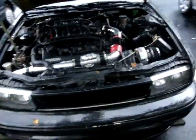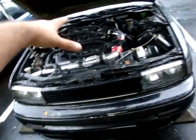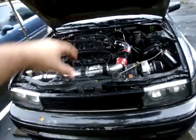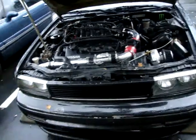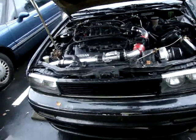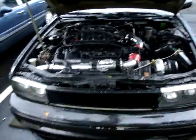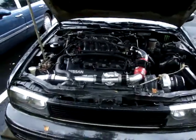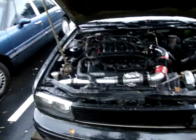The oil return line goes all the way to the oil pan. You have to take the oil pan out, which is a pain because you have to take off the crossmember on the bottom that connects to the motor mounts — that means you have to support the motor on top while you pull it out. Might as well put a new oil pan gasket, clean it up, and get it welded.